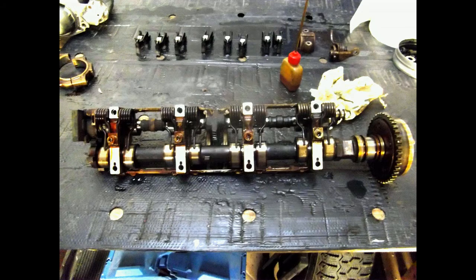I put the camshaft in the springs and bolted on the caps. These caps hold the camshaft and the intermediate shaft in place. I like to use light machine oil to pre-lubricate the bearings. Once the engine is back in the car I will start it without the fuse for the fuel pump in place, that way the engine can build up oil pressure without getting overstressed.